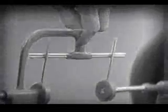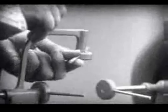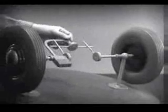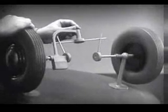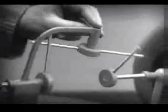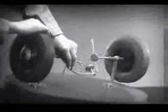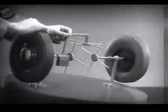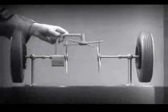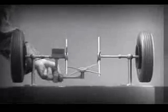Let's put this bar on a pivot so that it can swing in either direction. Now the bar can still turn both wheels at the same speed, and because it pivots, it lets one wheel turn even when the other is stopped. But if turned too far, the bar will swing around until it won't drive the spokes that turn either wheel. We need another crossbar and more spokes to carry on the job. When we stop one wheel, the crossbars will continue to push the spokes of the free wheel around. As long as both wheels are free to turn, the bars do not swing on their pivot, and the wheels move at the same speed. Now we have the working principles of a differential.